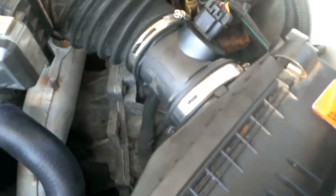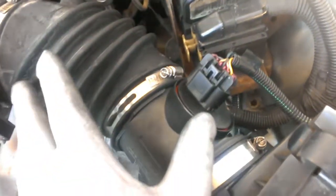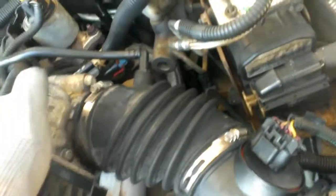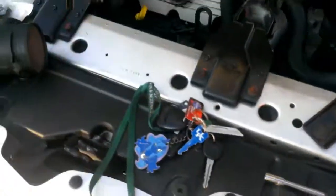She is now completely back together. Make sure you re-tighten this, this, and this. Double-check your work after everything's back together. Also don't forget to hook up this hose as well as hook up your sensor wire. Use dielectric grease if you have it — it helps keep moisture away from the inside connections.